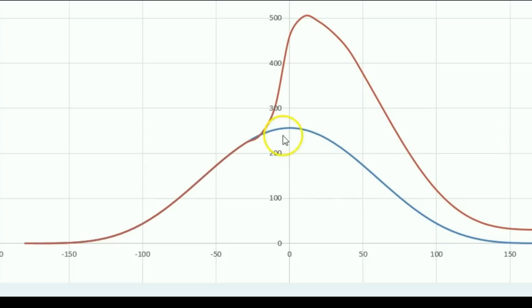So that's why for ignition timing, for every certain load and for every certain RPM, there is going to be a certain point where you will fire the spark plug, where you will get the most amount of torque out of the engine. And that's going to be the most efficient point to fire the spark plug, and it's going to be what's going to give you the most power. If you fire it too early, then the wastage over here will be too much, and the gain you will get from that will not be enough. If you're firing it too late, then obviously the wastage, you're throwing all the air-fuel mixture out of the exhaust, will be more than whatever you're gaining by not wasting the energy over here.